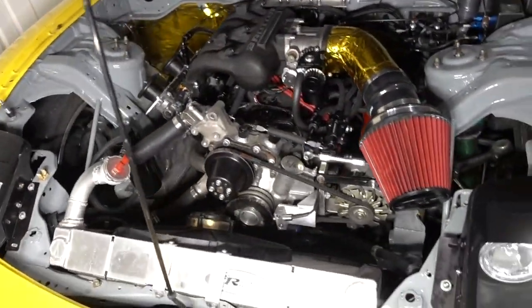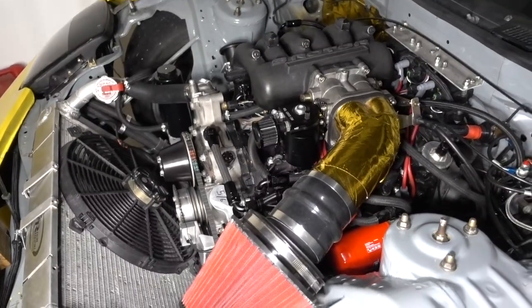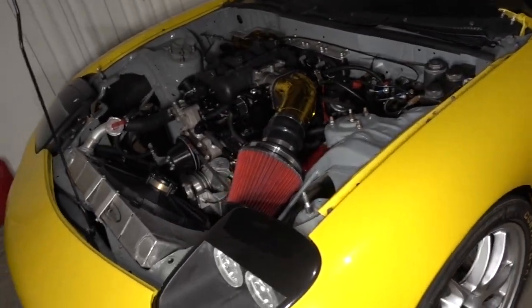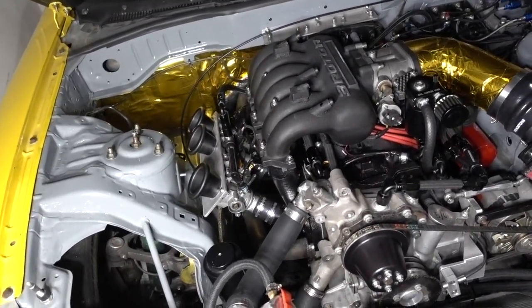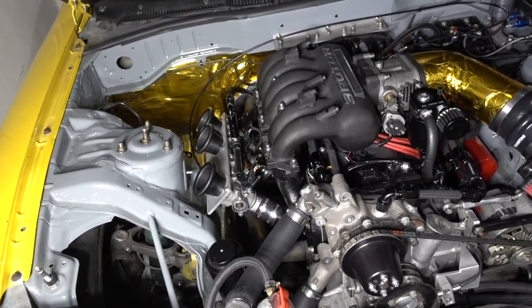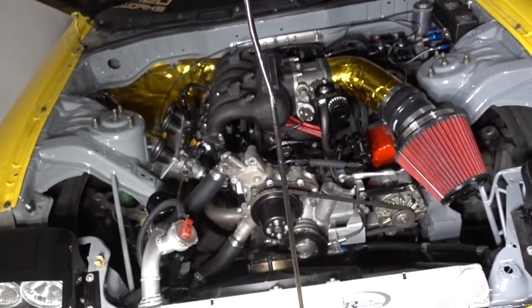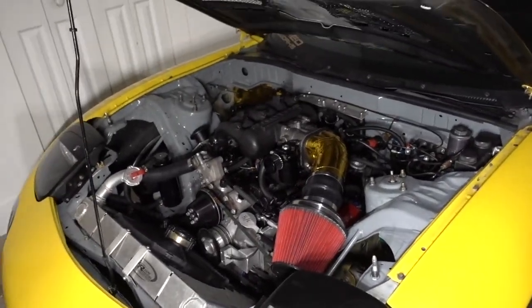Hopefully you have a better understanding of the setup. This is a pretty radical, very well-developed engine. It's got ceramic apex seals, crazy amounts of balancing done, and it revs really high. Those semi-peripheral ports don't really help much until you get up into the higher revs — they're only good above about 6,000 to 7,000 RPM. Below that RPM, the motor doesn't need the extra air, and opening them up actually over-feeds the engine.